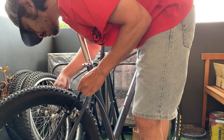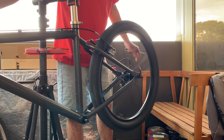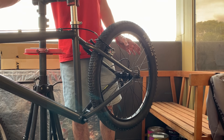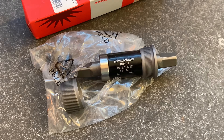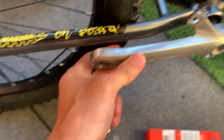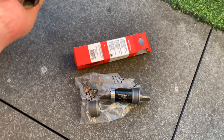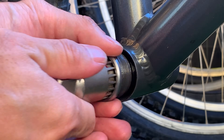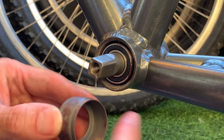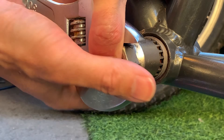Putting on the back brake — the rear wheel was way more true, which made life way easier. Cut off the excess cable, making sure it's working. A new bottom bracket came in — this one is 124.5mm versus the old 127mm, but it still sticks out enough so it should work. I measured against the middle ring to make sure it lines up with the middle of the cassette. Took off the old BB again, re-greased, and put the new one on — fit really well and spins really good. Pretty stoked to have a new BB; it's going to make the ride way better.